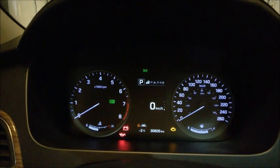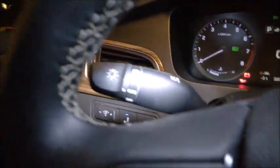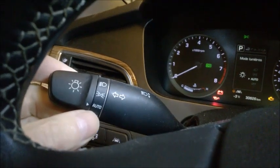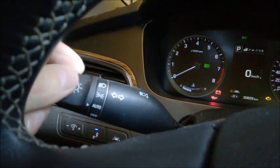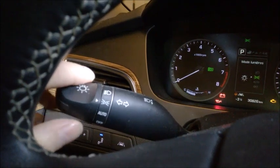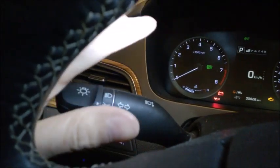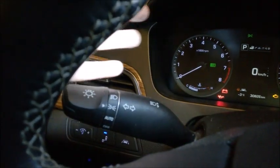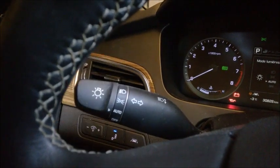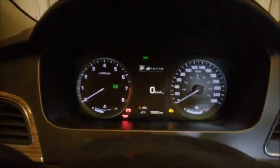A short word about the daytime running lights on the 2016 Sonata. On the left stalk we have this knob to adjust the lights. I always let it sit on auto and I recommend not turning this knob at all - just leave it there. If you turn it to another position, you'll have the lights on the dash but the front headlights won't turn on, so you may drive at night with the headlights off. That's not safe for other people. Always keep it at auto position.